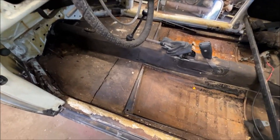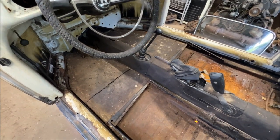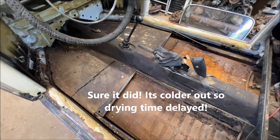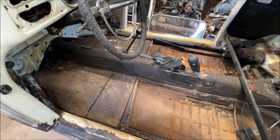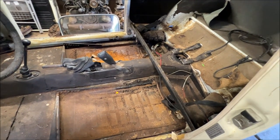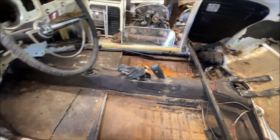So this is what we're dealing with. Obviously the tarboard's left in front, so we're going to get that removed, then wire wheel, clean all this up, and hit it with bare metal primer. The rust bullet that I got, discussed in an earlier video, we're going to put that underneath the car, because inside I'm really not going to have much problems with being exposed to the elements. We'll continue in here because I got a couple holes to fix.